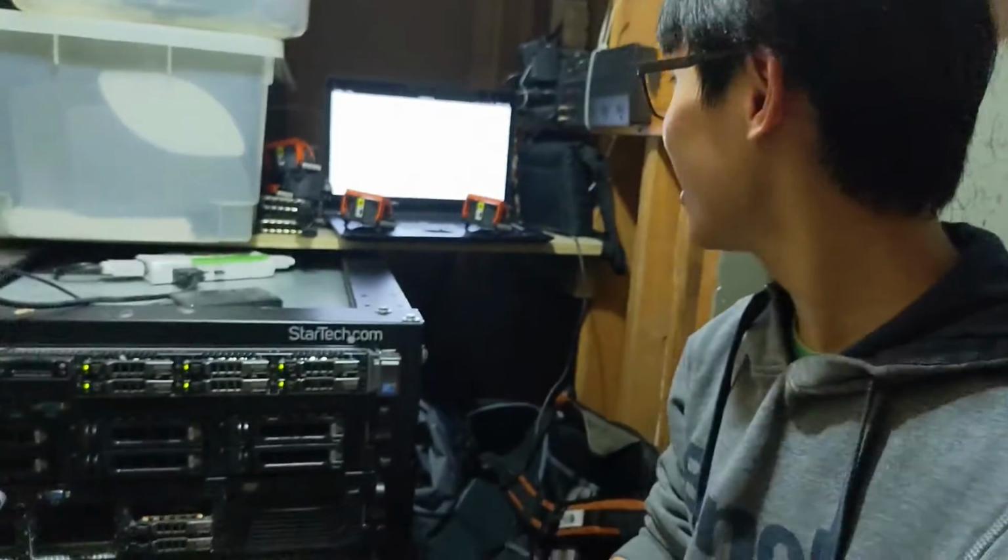That's awesome! So unfortunately, I didn't record what the unmodified fans sounded like with this Blue Yeti microphone. I was going to do a before and after comparison, but then I got a bit too excited. I wanted to put the new modified fans in as soon as possible and see what it sounded like. And I'm really pleased with the results, but just to give a fair comparison between the modified and unmodified fans, I'm just going to put the microphone down, shut up for a bit, so you can hear what the modified fans sound like, and then I'm going to turn on the old 2950 with the unmodified fans, and you'll see how much of a difference the resistors really make.